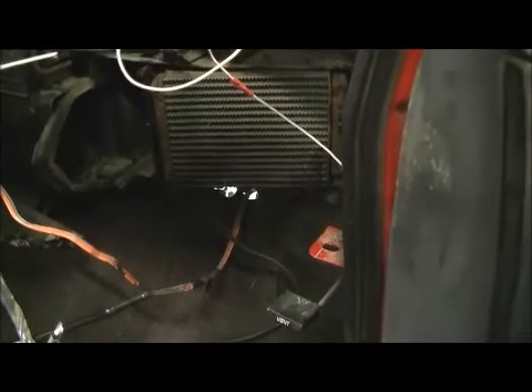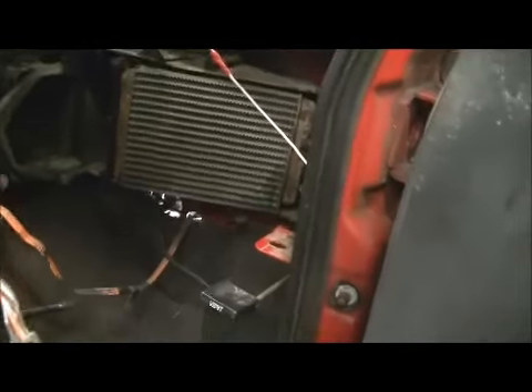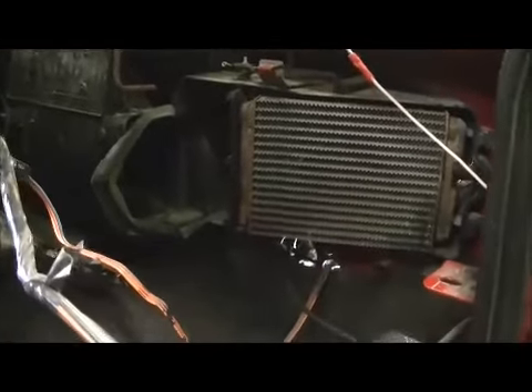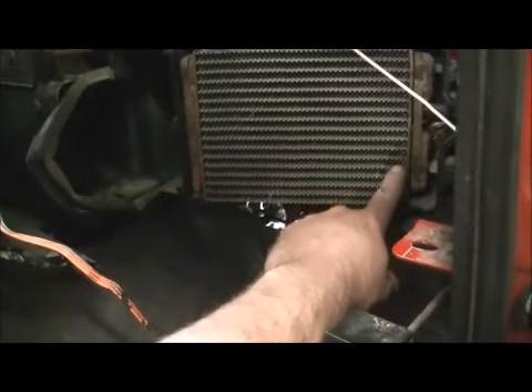If you're wondering where they go, they go under there. They run sideways and the blower fan blows air through it. There's a bypass over here if you want cold air to come through, but this truck does not have air conditioning — it did not come out of the factory with air conditioning. That's why it's a little easier. It just had this big nice cover that snapped over this and had screws around. You can see right there where it was busted, where it's leaking.